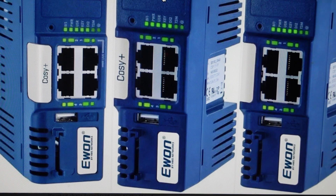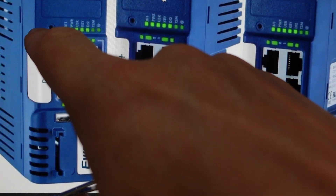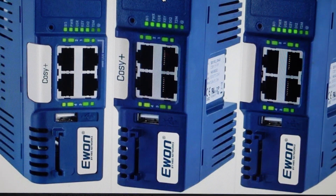All you need to do is start by turning it off. Then with a paperclip or whatever, come in and find the reset button and press and hold it while you turn it on. The BL1 light should light up in green. Keep that reset button pressed for about 35 seconds until the USR LED is not blinking red anymore but goes steady red.